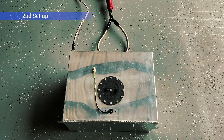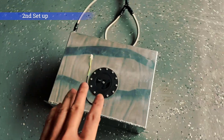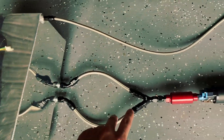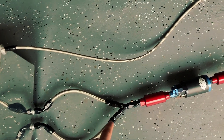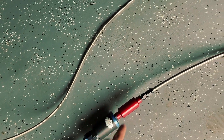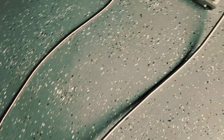Here's the second setup for the fuel system. You have the fuel cell. Same thing — you got two lines going out to the splitter. From the splitter: fuel filter, fuel filter, fuel pump, fuel pump, fuel filter, and then you come all the way down here.